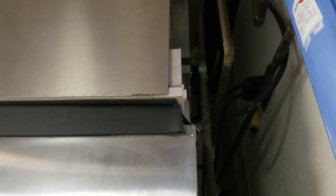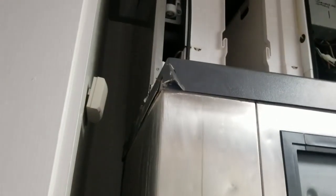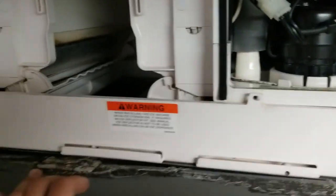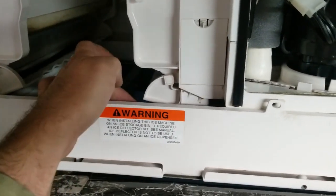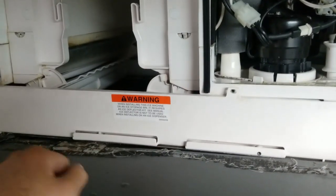The machines are staying put. The bin top is moving. So that's why that's happening. If I close this, it'll start making ice. But it's because the machine's not sitting level that the curtain's in a bind, and it's sticking open.